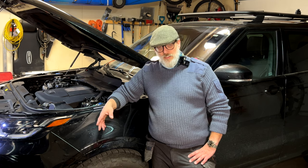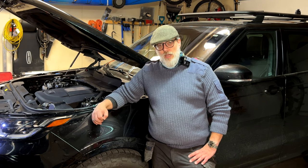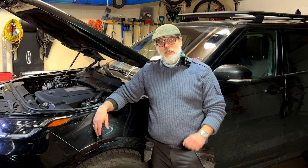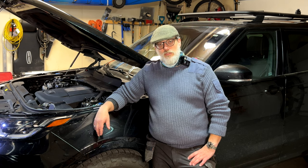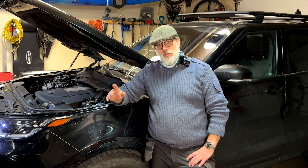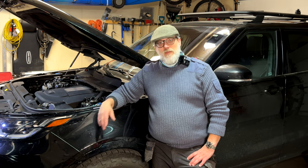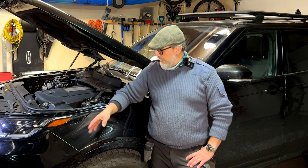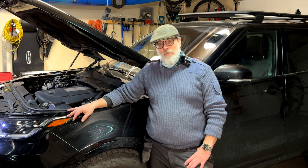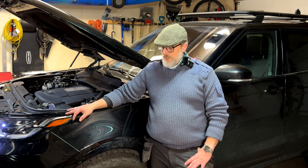So what I'm trying to say is, be careful if you're going to use a product from a garage or whatever. Make sure that it does meet ISO 22241-1, and if you are going to fill up at a pump, make sure they have a good reputation for good quality DEF. If you fill it up with poorer quality DEF, well, you end up getting particulates and dust and debris in there. The Land Rover may decide to tell you that it's running on, what does the error say?